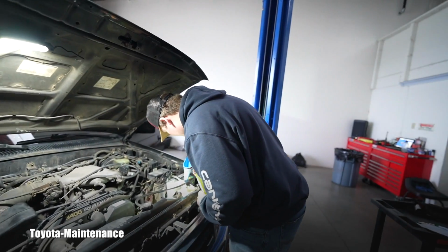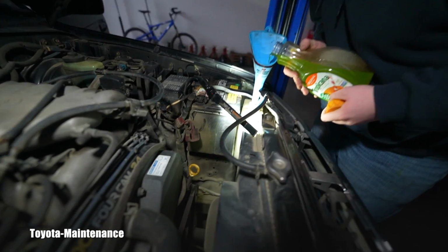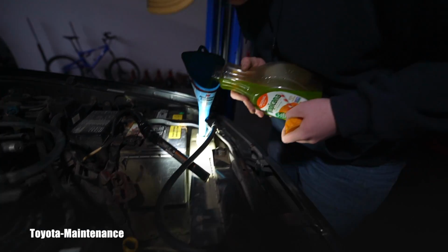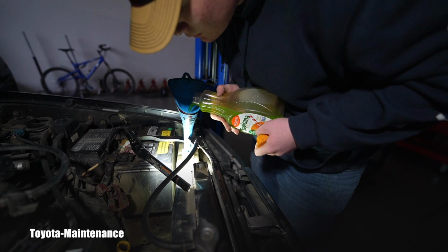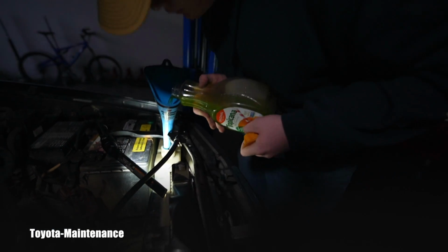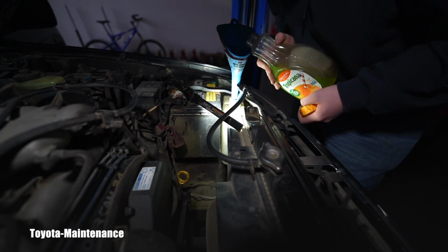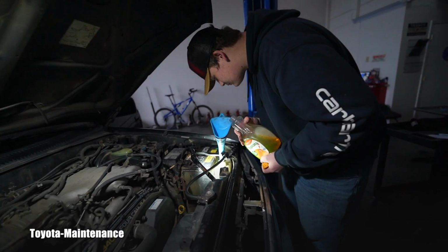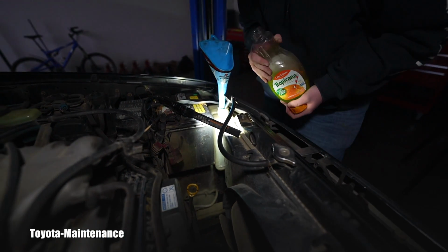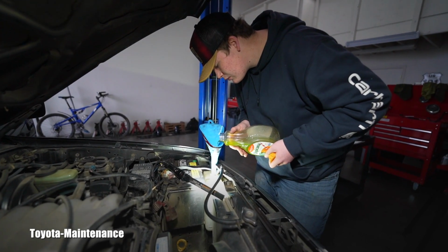Good. So Izaak discovered that he has a green coolant in the radiator and the level was barely above the L as a low. So he's right now adding, nice, and watching the level to rise towards the F in the expansion tank, and he will have at least correct level of the coolant. The coolant should be red, Toyota, but for vehicle with this miles, this age and so on, that should be fine for now. What do you think? Did you get it there? Let's see, maybe a little bit more.